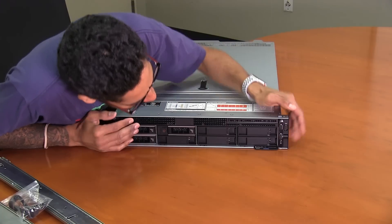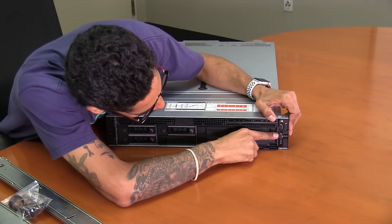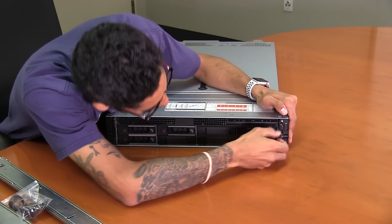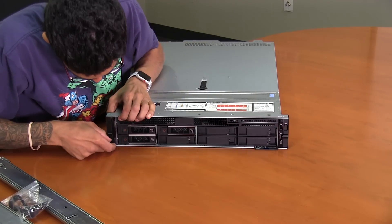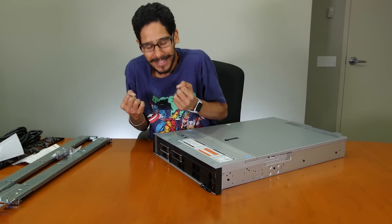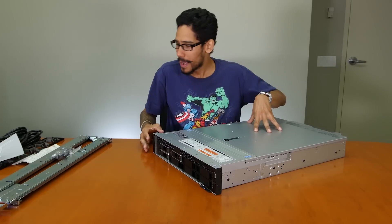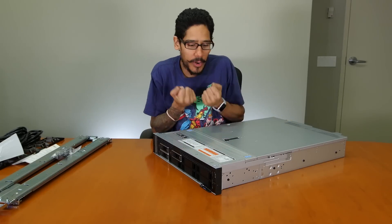In the front, looks like this is your VGA port. We have additional USB ports — either 3.1 or 2.0, I'm not too sure. This looks like the management port here. I'm going to remove the sticker. This looks like an information button — most likely this is going to light up. I'm going to power this guy on. I'm going to connect both power supplies, get a monitor, VGA, keyboard, and mouse set up so we can power it on and feel the power.